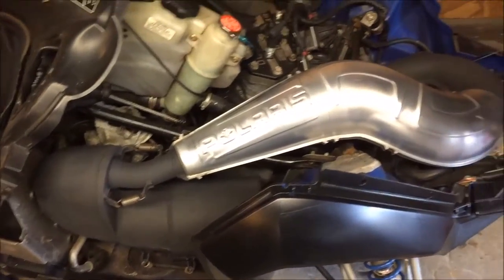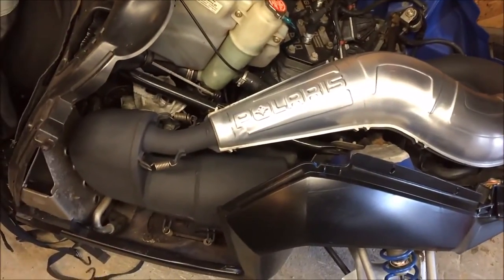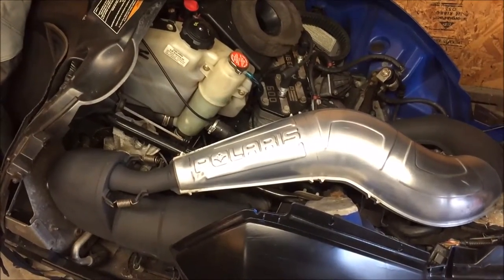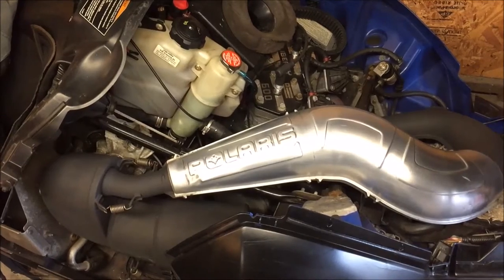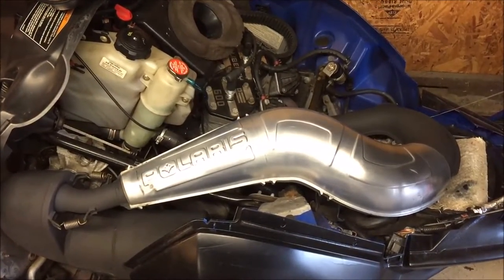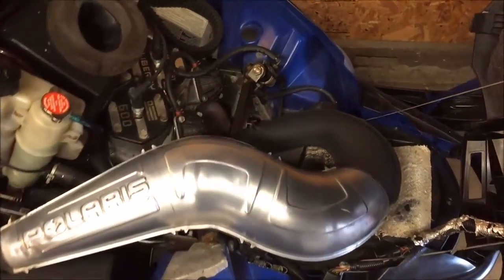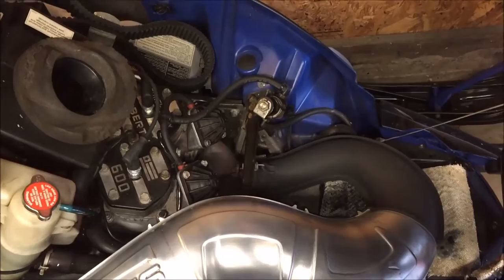Here's the silencer and pipe back in the sled, with the cover on just to give an idea of what it's going to look like — it looks a lot better than what we started with. For heat curing: start it up, let it idle for about 15-20 minutes, stop it, let it cool for 10-15 minutes, start it up again for another 20 minutes, then let it cool again and run it at operating temperatures for a full cure. Since it's still October, we'll just do the two heat cycles. I still need to paint the Y pipe — I'll just mask it off and paint it in place.